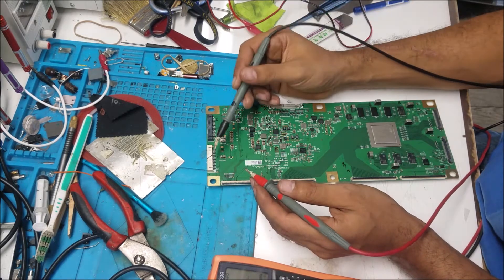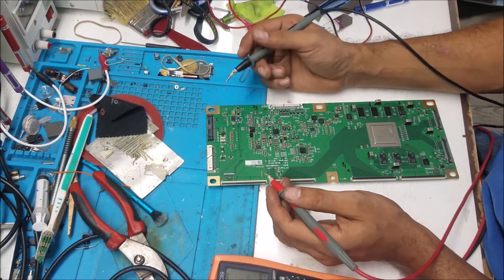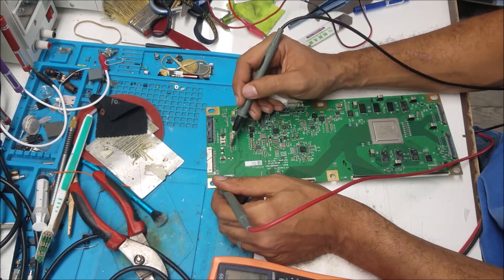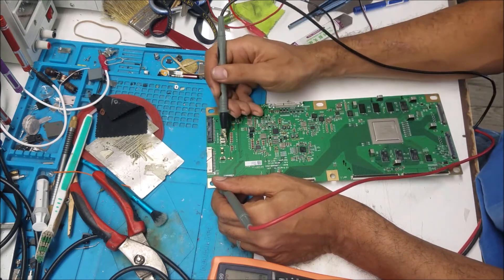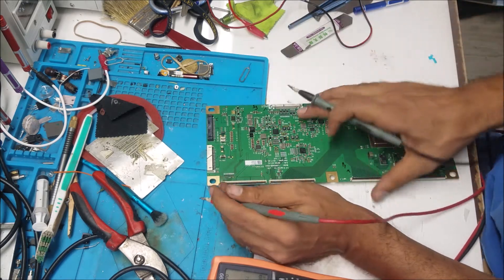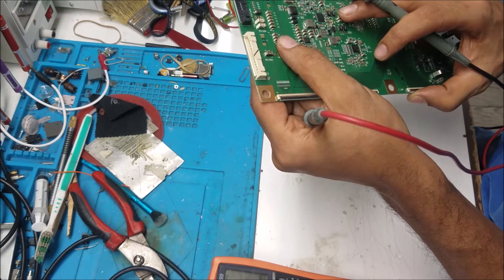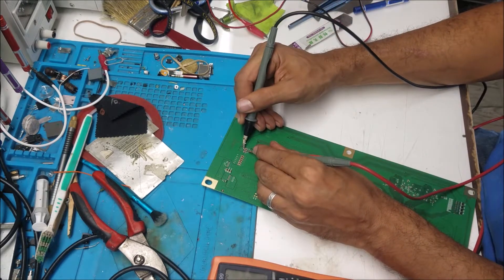As you did see, I checked the power board — we have 12 volts and 24 volts. But the TV shuts down very quickly. From this fuse, we have these capacitors here. This is the ground side, and this is supposed to be the 12-volt side, but this is grounded as well. From here it goes to these capacitors, meaning these capacitors are shorted as well.